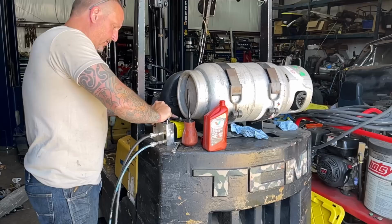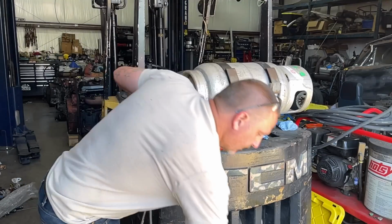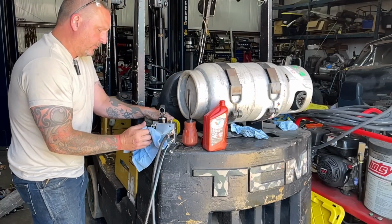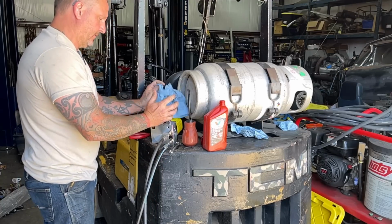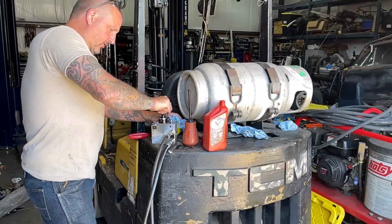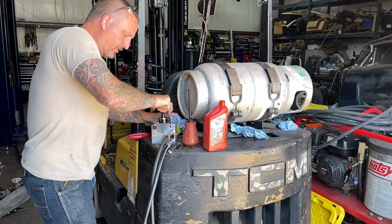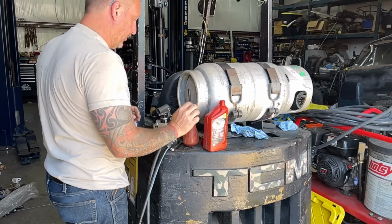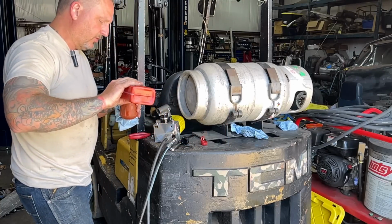And that's how it should be, because it's a two-way cylinder, right? So when you pump the cab up, the down cylinder is exhausting fluid, and it has to have a place for that fluid somewhere. And so this pump is able to pump through. All my other pumps built pressure both directions, so you couldn't pump it up or down. So I think this one is good to go.